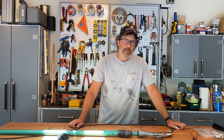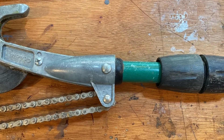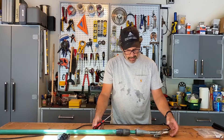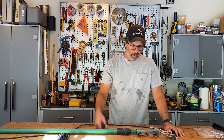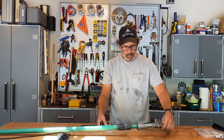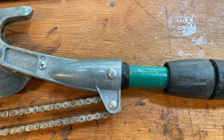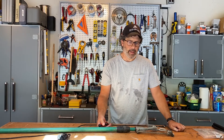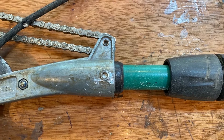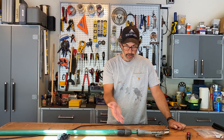First thing I want to do is disassemble the current head assembly, so I'm going to remove that bolt and nut. But I see there's a flat, smooth head bolt here — I can't do anything with that. It's a trick: there's one nut and bolt to reassemble, but there's not a nut and bolt to disassemble. These are tough to get off — this was assembled in the factory with a machine tool. I searched all over the internet and there are no instructions, no way to tell me how to get this head off. So now I have to figure out how to remove the head from the shaft without destroying it.